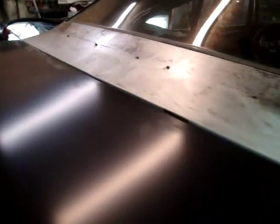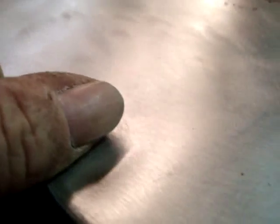I showed you how thick that filler was right here. See that dent right there? There you go — it's the size of my thumbnail, that's how big the dent is. There is an access hole in the inner panel underneath; I can get through that and push it back up. Everything else here is smooth and straight as can be — just that one dent. Fix that, and it'll take care of all that filler that was in there.